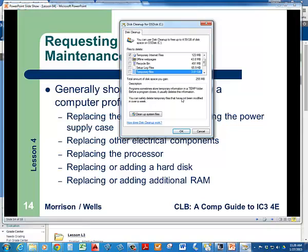It's stuff that loads from browsing or from running application programs, particularly AutoCAD. It will leave temporary files so that you can go back and open up an existing drawing or recover a drawing. So I haven't done it in a long time. Almost 4 gigabytes of temporary files. And that can be causing fragmentation quite a bit, having that out there. Okay, so you can choose all of it and clean up the system files and everything, and that should improve your speed.